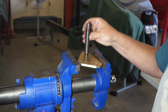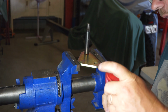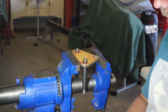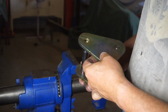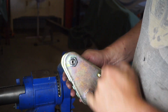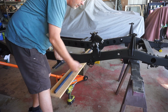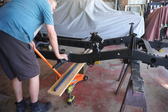So I got the front knocked over, and now it's time to do the rear. And it's pretty much the same as the front. The shackle plates are just a little bit different shape, that's all. That plate then sits over top of all of them. That's it, completely assembled. Just need to put the Zerk fittings in the end of that so that the grease can go through them. Now I gotta raise the chassis up to get these horses out of here so that I can get the springs under there and then the diff under there. So I'm hoping that this is gonna do the trick.